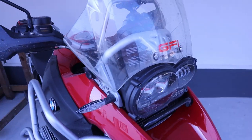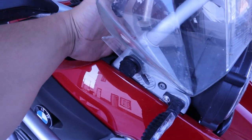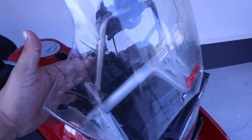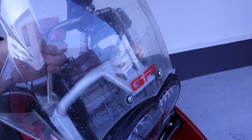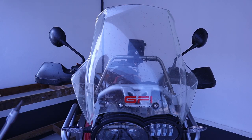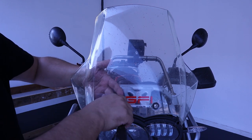This process should be really simple. We need to remove these two bolts right here and also untie this one, and take all the stuff that is inside. In my case, I have this bracket here to hold the GPS mount from Touratec. I will leave it on for the moment, take the windscreen away, then test fit the new assembly and see if I can keep this bracket or if I need to mount the GPS directly on the frame of the windshield. We start with a Torx T25 to undo these bolts. I didn't check the instructions yet, but I think we need to reuse these ones.